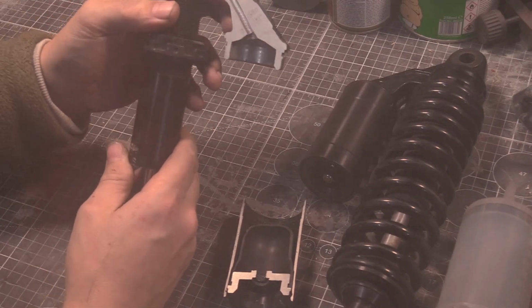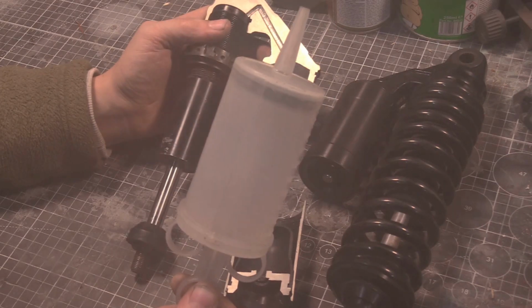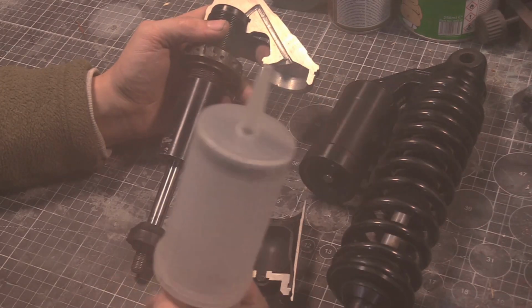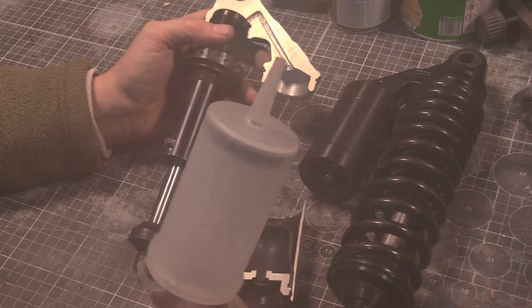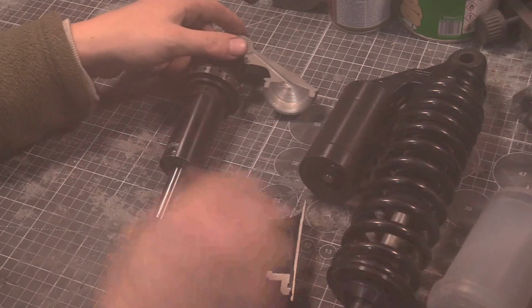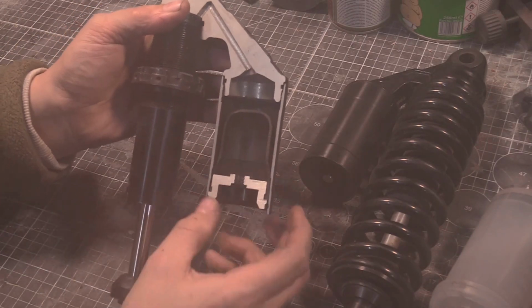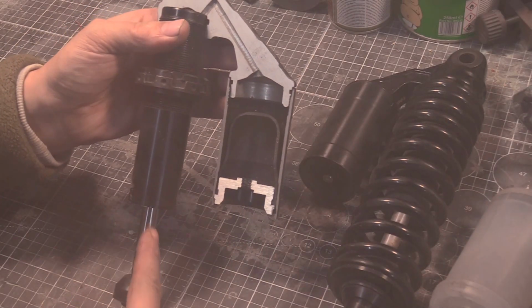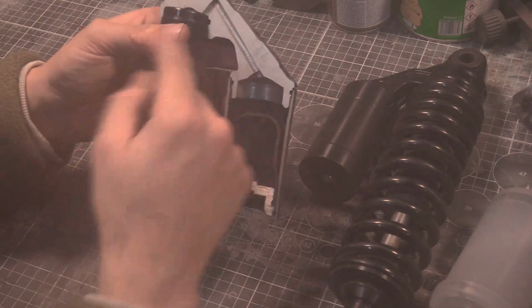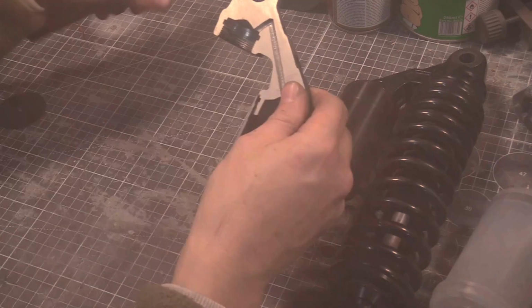Oh, yes. Right, so, this is what you always need to think about when you think about suspension, right? And I might even just cut this stuff off and get a little silly spring and even get a tube and a little clear cylinder thing which I can show you. But anyway, then you have all these gubbins. So we know what this bit's doing, right? We have a rod with a volume of oil that we're pushing up, and it goes through these holes and into this chamber here. So in a sense, we can forget that, right?